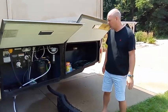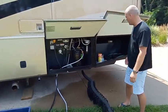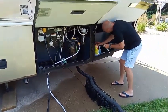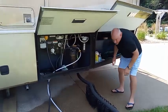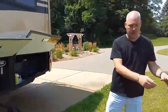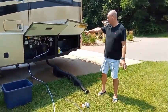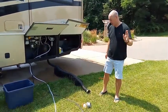Once that's all shut off, since I've just sanitized, I'm going to do my water first. I'll have my wipes ready. We're going to come over and disconnect from our campsite first. The reason I like to disconnect there is in case I didn't turn the water off all the way — if I disconnect at the campsite end first, I know I'm shut off. So that's disconnected.